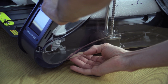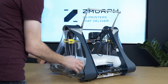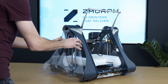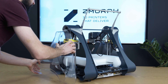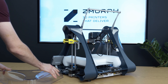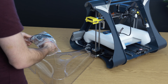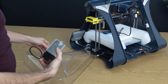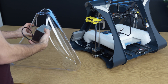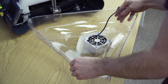To install the HEPA filter we need to disassemble the side cover. Gently squeeze the cover on the left and right side, then squeeze the cover on top and push it towards you. Now take out the HEPA carbon filter from the back. Take the carbon filter and put the wire through the hole on the side cover. Place everything on a stable table.